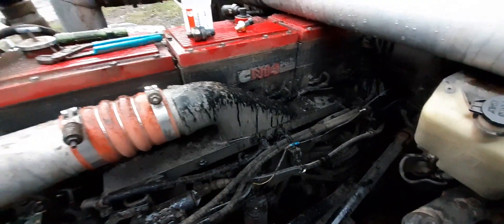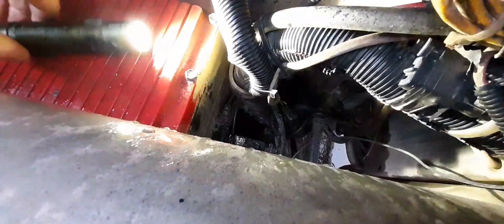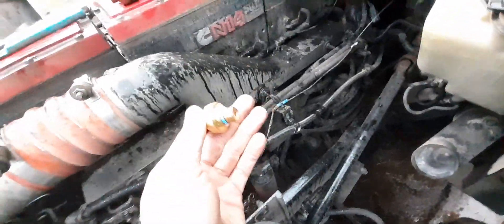It'll also mess with your jakes on the back of the intake manifold — back here, see if you can see. It sits right here, there's the back of the intake manifold. It's not very friendly to get to, but you can get back there with a pair of channel locks. It shouldn't be very tight — hand tight plus maybe a half a turn with the channel lock. You can see there's a hole right there and that's where it goes in. The plug is there as well, not much of a pigtail, maybe an inch and a half at most. So do yourself a favor before you start changing injectors — check this $18 part.